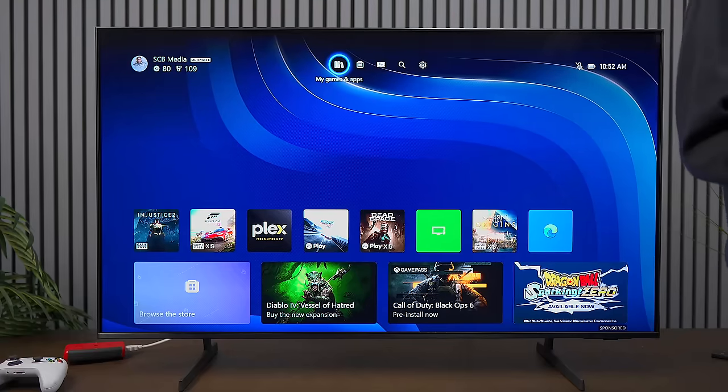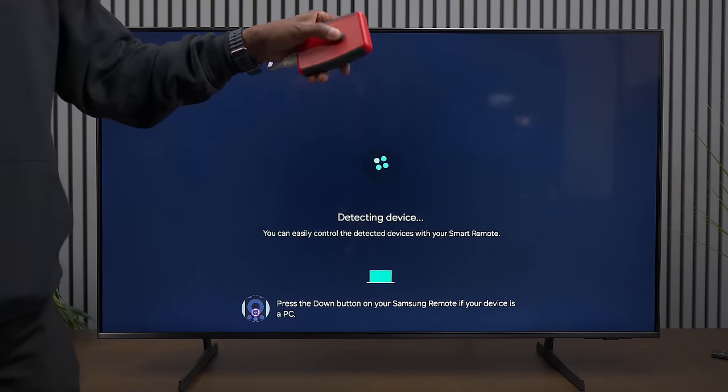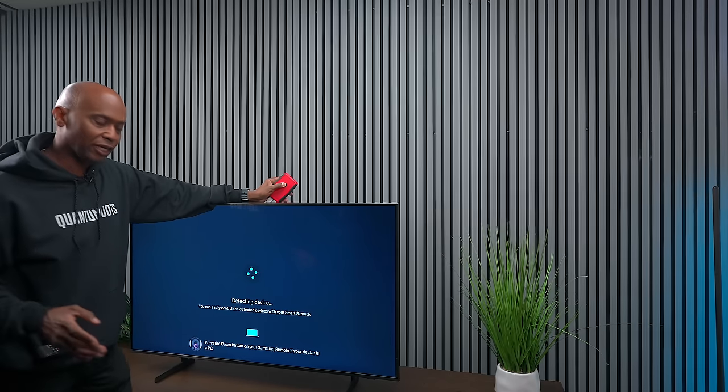If you plan on buying this TV for gaming, there are a few things to consider. This TV maxes out at 60 frames per second. The 120Hz motion processing is a feature to help smooth 24fps movies — it has nothing to do with gaming. I'm going to use an input lag tester to test how fast this TV responds over HDMI. One thing that really stands out is how long Samsung TVs take to detect a signal — sometimes up to one minute.